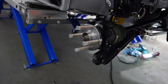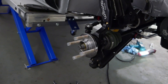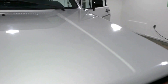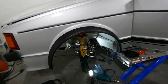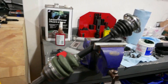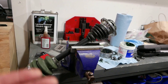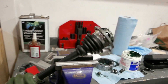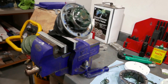You can see I got the new axle going in here. On the long side it was fine — I could do it with the shock in. But on the short side I think I'm going to have to pull the shock out. What happened is I had to bend the angle on the inner joint, just because where the strut drops so low, the angle has to be really steep. And because the thing is not torqued in, it's very easy to hyperextend it.